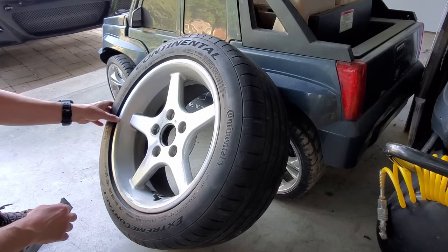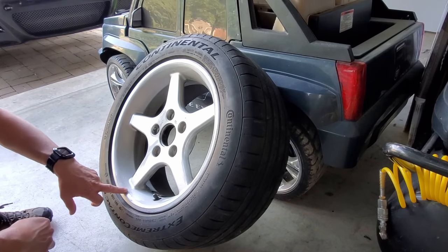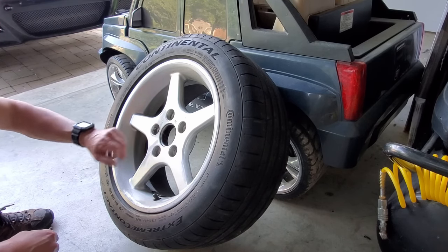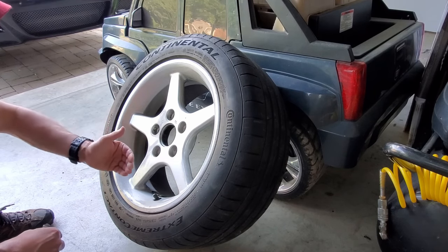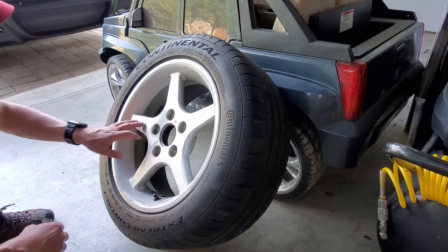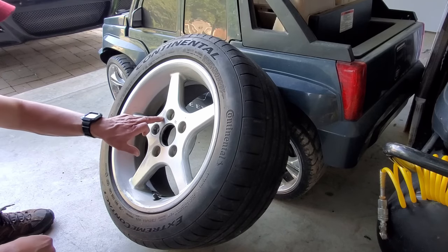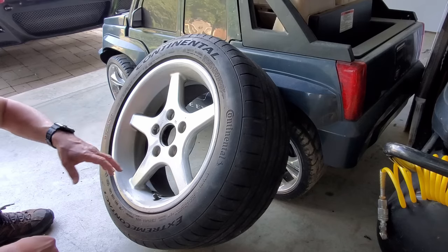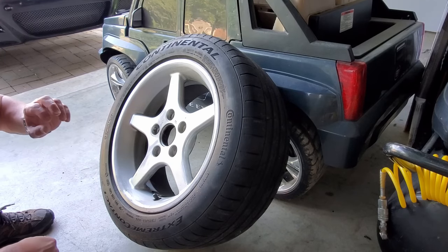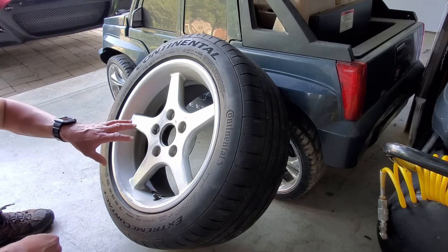I managed to get off all of the PlastiDip and now I'm sanding many of the gouges and scratches that were there before it was originally painted. There are a few that are deep enough that I'm going to need to apply some body filler to fill them up and make the surface flush, then lightly sand them before I prep for the new AutoDip vinyl paint. This wheel is riddled — it was an abused wheel. Prepping it so it looks nice and smooth is the majority of this job and gives it the best possible chance of looking very attractive.